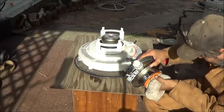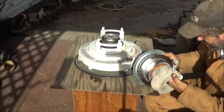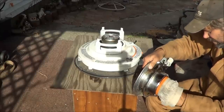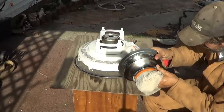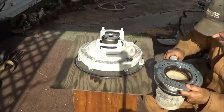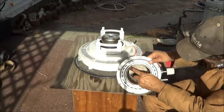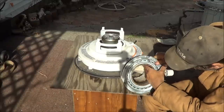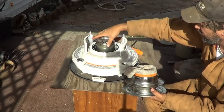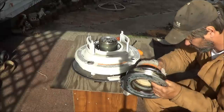It's hard to do this and try to make it so you guys can see. I've got the wick in there and I rub it around good to make sure it sticks into those little prickly things. But somehow I've got a wrinkle right in here in the wick. So now I've got to go around and try to spread this out and get rid of that wrinkle, because it slides over the top of this neck in the kerosene heater. If you get any wrinkles and it doubles up, it will make it not want to go up and down right. So let me fix this.